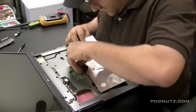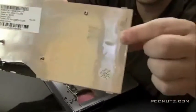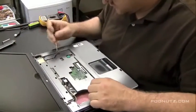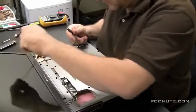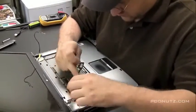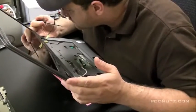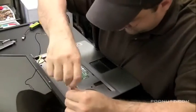Swing that keyboard out — you'll see that there are posts under that keyboard that hold it in. We luckily took those screws out earlier. Now let's get the wireless cables out, and then the LCD cable. Those wireless cables are just the antenna that go to the top of the screen and feed through to the wireless card. They're always a pain, those wireless antennae, but they try to get them up to the highest point on the laptop to give you better reception.